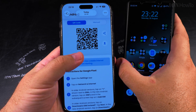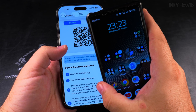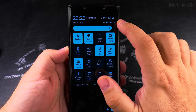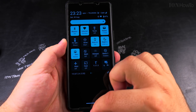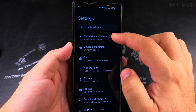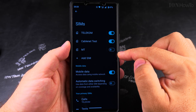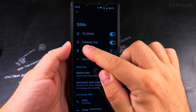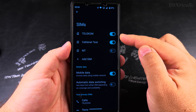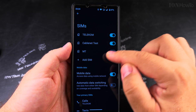This is the QR code — it's a single-use QR code — and I'll scan it with my Android phone to install the eSIM on Android. On my Android phone I already have an eSIM that is enabled and active, plus a physical SIM. You can have multiple eSIMs but only one can be active at a time. Go to Network and Internet, then SIMs, and here you can see the eSIMs on the Android phone.